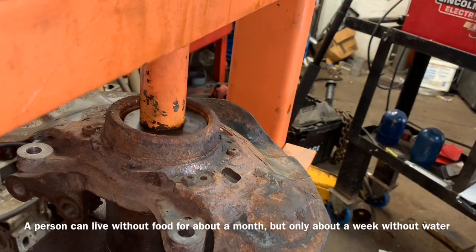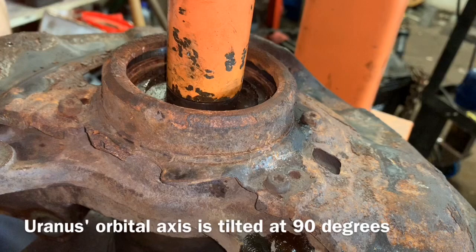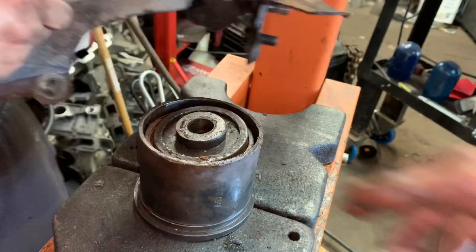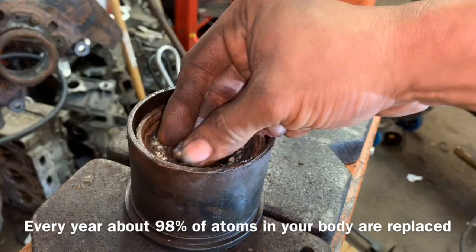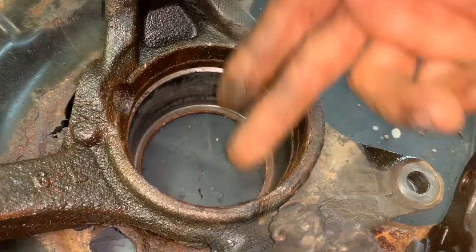She just popped — sorry I didn't have it on video for you folks, but she's coming out now. Push down inside the cup, which is what we want. Once you've got that bearing out of there, we want to make sure that this area does not have any grooves in it. You can take some emery cloth or fairly fine sandpaper and sand that out if you have any grooves, and then obviously our bearing goes in this direction.